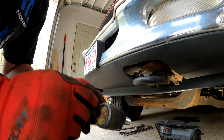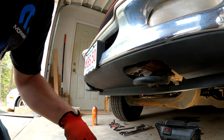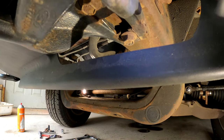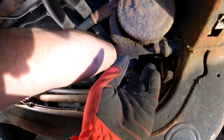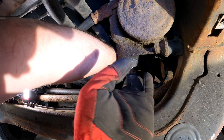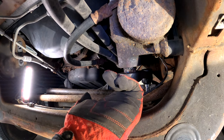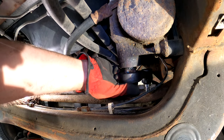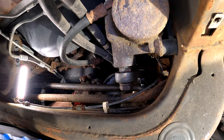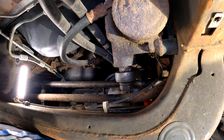Here's our new pitman arm — got the boot on, grease fitting in, and I marked it where I took it off roughly. This is going to have to go for an alignment because the entire front end has been taken apart and rebuilt, so we'll get it close. There's my red mark — it's permanent marker. Pretty much lined up there, pretty dang close. I'm going to put this guy back in here just for now just to hold it in place. Center link's back in. We'll get our castellated nut and move back over to put our idler arm on. Then we'll be able to snug everything down and torque it.